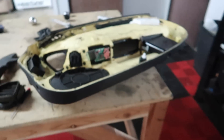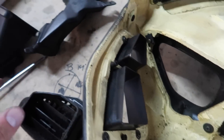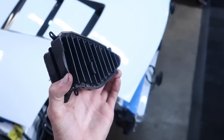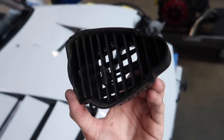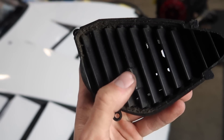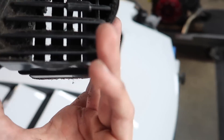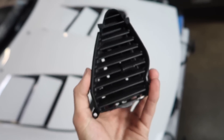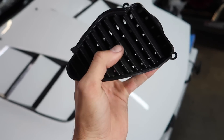Before I put the door panel back in I wanted to clean it up, and I noticed I didn't do a good job cleaning the vent on the inside of the door. I flipped it over and found only a couple of screws holding this whole contraption together, so I was able to get this AC vent out. You guys are gonna freak out how disgusting this is. It looked pretty clean on the outside but the inside had all this black fuzz — really difficult to get a screwdriver in there. Flipping it over — oh my god, disgusting. I hosed it off at the sink and rinsed all the junk out. After deep cleaning and rinsing, this piece literally looks brand new. I'll probably do this with all the vents because it made a night and day difference — it moves and swivels a lot better now.